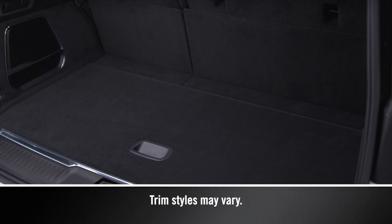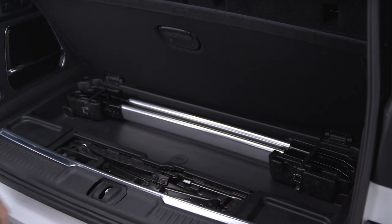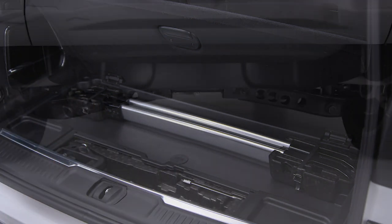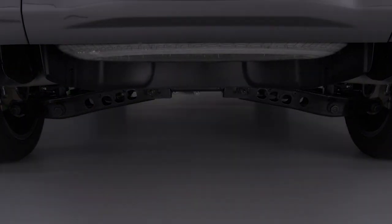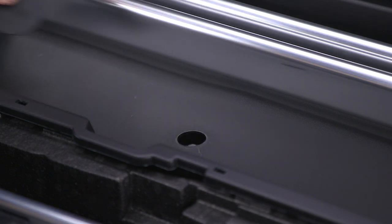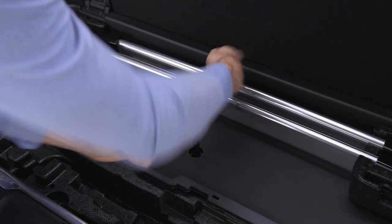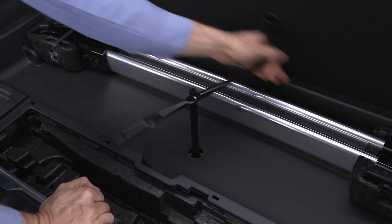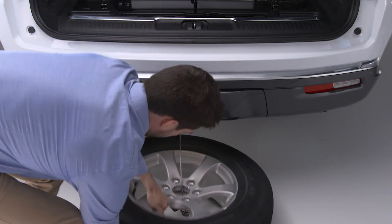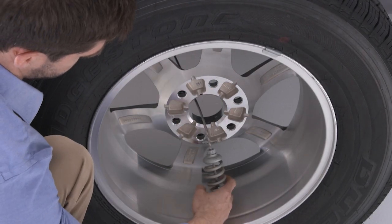Next, retrieve the tire changing tools. You'll find the scissor type jack and tire changing tools in the rear cargo area under the load floor. Remove the storage cover and then lift the jack and tools out of the storage compartment. You'll find the spare tire underneath the rear of the vehicle, held in place by a cable winch mechanism. Remove the plastic plug covering the access hole. Attach the lug wrench to the jack handle extension and fit the extension over the drive nut. Turn the lug wrench counterclockwise on the nut until it stops, and the spare tire is on the ground with enough slack in the cable to allow you to pull the tire out from under the vehicle. Pull the metal bracket toward you until you can rotate the bracket and feed it through the hole in the wheel.